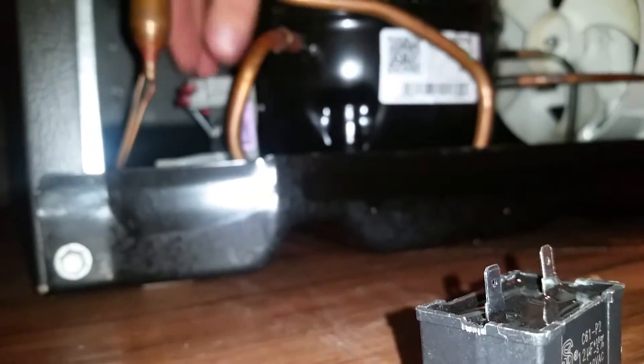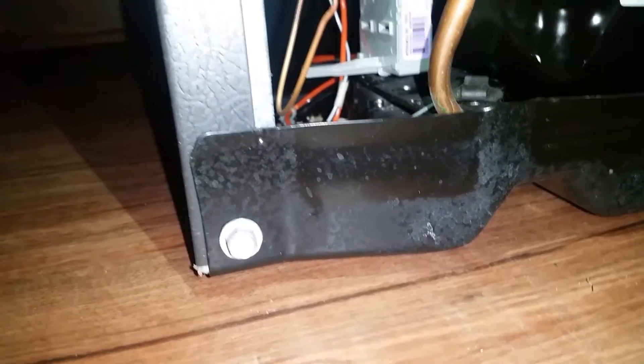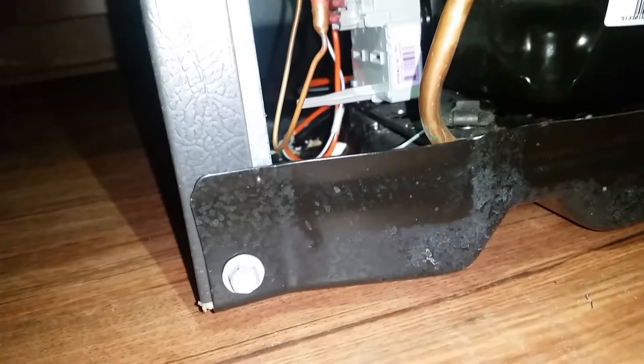The relay is inside here. It's kind of like an air conditioner capacitor, but it's a starter kit and a relay. This one here is the starter capacitor, and it's got the wiring and starter pack. We can try changing just this capacitor and go from there. We can test it — it's a 12 microfarad capacitor. We can take that back and test it to see if it's bad. A lot of times it's the whole relay, so we'll take it back. There's a little spring-loaded deal, and rather than pop it apart if it's just the capacitor, I'm going to check the capacitor first. Next would be this relay — it comes off and it's got three prongs, just like a capacitor.